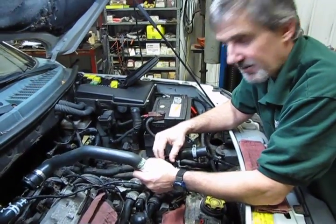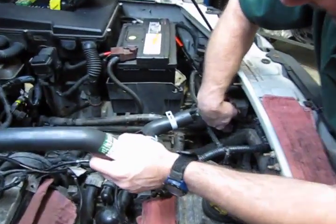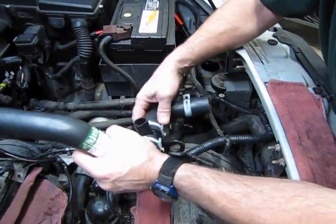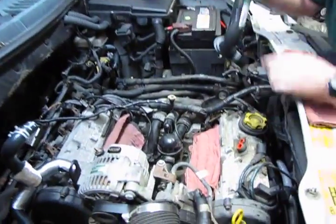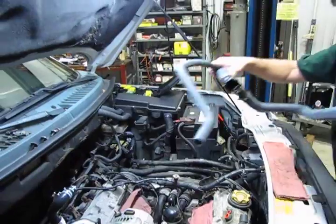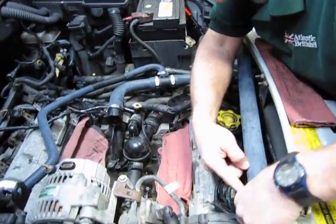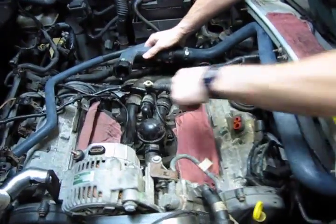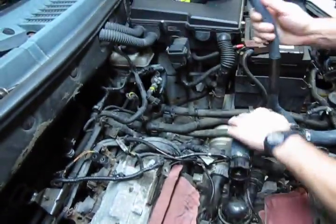Then you can install it in the new hose, drop this back in place, same thing, unclamp, pull a hose, install new hose, and this is just a quick disconnect. This will plug right in. And you have your upper hose, which runs across the top of the radiator, plugs in here. This will plug in here, and this essentially runs straight across. You'll see it.